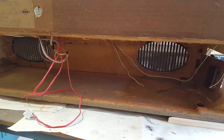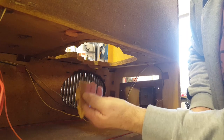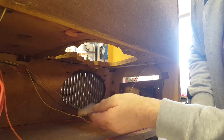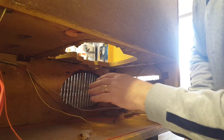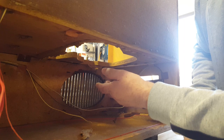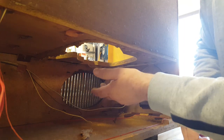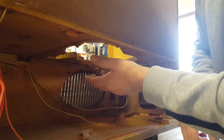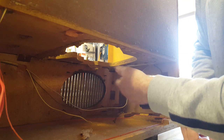I'm going to start reassembling the cabinet. The vents on the end for the electrostatic speakers are going in, and I can put the original repaired speakers back. I've painted the interior with varnish to keep the chipboard together - it can start to flake if it gets a bit moist. There's something else I need to do before putting parts back in - this is the cutout for the record player, and there are bits of cardboardy fabric hanging down. I think it probably had a cover here over the speaker area, and someone's just ripped it out or it's fallen apart.